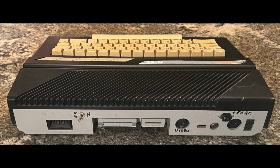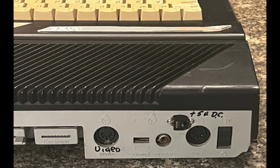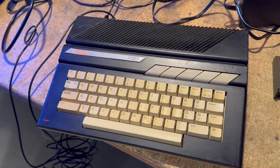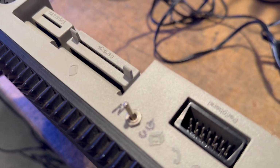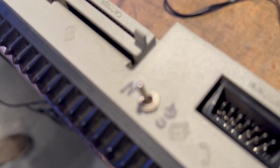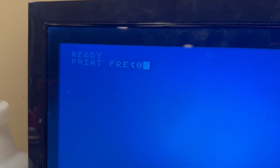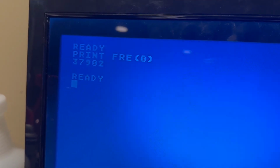It's not like I need a 130XE, but the idea that maybe it has interesting mods was too much for me to overlook. So the power seemed a little flaky to the touch, but it otherwise works fine. I tried the switch, but there was no discernible difference to how it powers on either way. I predicted it enabled an internal memory expansion of some type, but I ran the command that shows available RAM, and on both settings it returned the same amount.